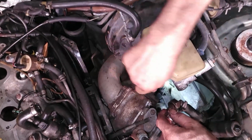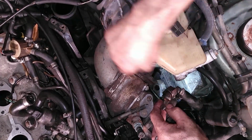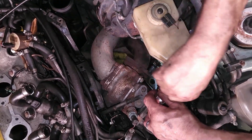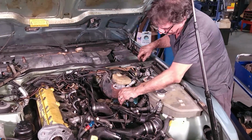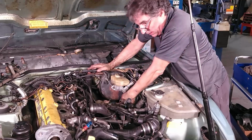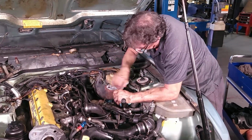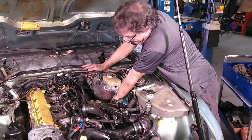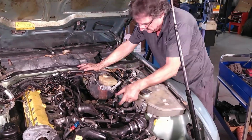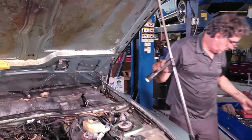Sometimes it's easier if the bolt just breaks. We're going to replace the hardware anyways. But 10 millimeters is pretty hard to break unless it's rotted through. Still a little warm down there. I also picked up the hardware I dropped while I was down there. The bolts are now out of the exhaust flange, if you want to take a look.